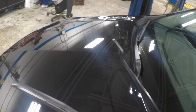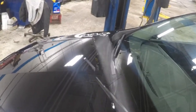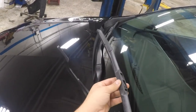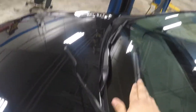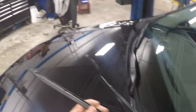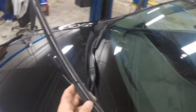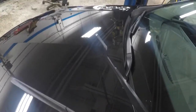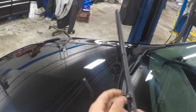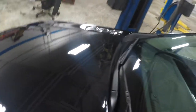When the hinges don't work correctly you get wipers that streak. One thing to watch with covered wiper blades: they tend to catch a lot of wind, so on the highway that wind can actually lift them up. But if you look at this blade, you'll see it's different on one side — this company has put almost a fan blade effect on this side, so the wind going across the windshield actually helps hold the wiper down. So it just goes to show you that different blade companies and different innovations mean if you spend a little more money on blades you get a better product. This blade here is standing nice and straight, no rips or tears, the rubber is nice and supple — not hard. When rubber gets hard, that's when you get that chattering going across the window. This blade looks good, so we'll reinstall it: flip that little clip up, line it back up, slide it in until it bottoms out, and hit the lock down. That blade's done.